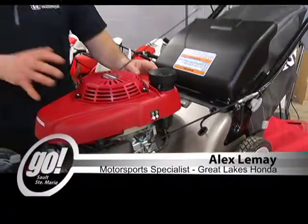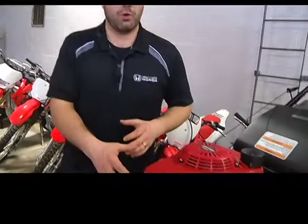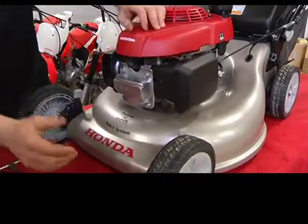So when it comes to the fuel and the gas tank on the lawnmowers, in the fall, good practice is to put fuel stabilizer in the tank and top them up just to make sure your gas lasts throughout the winter. Even if you've done this, you have to drain the carburetor bowl underneath. Gas will go bad quicker on that area of the lawnmower.